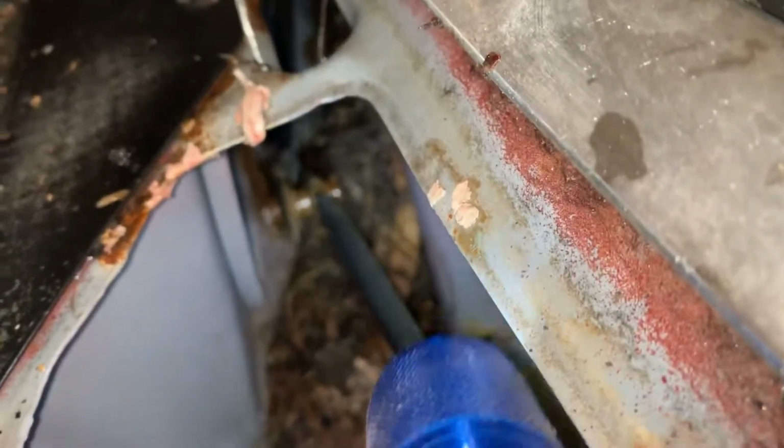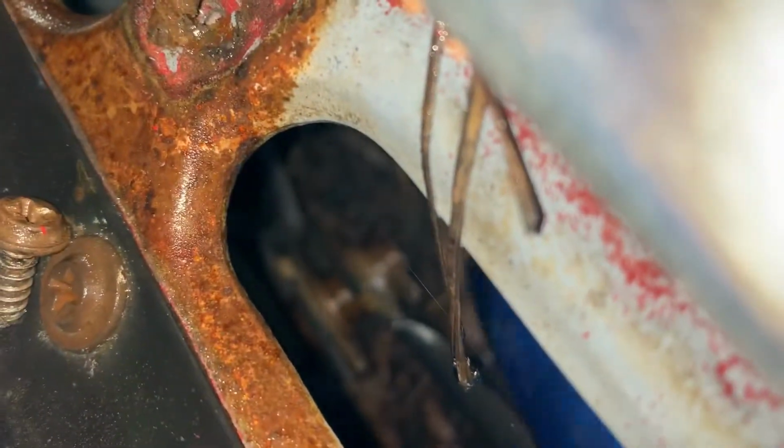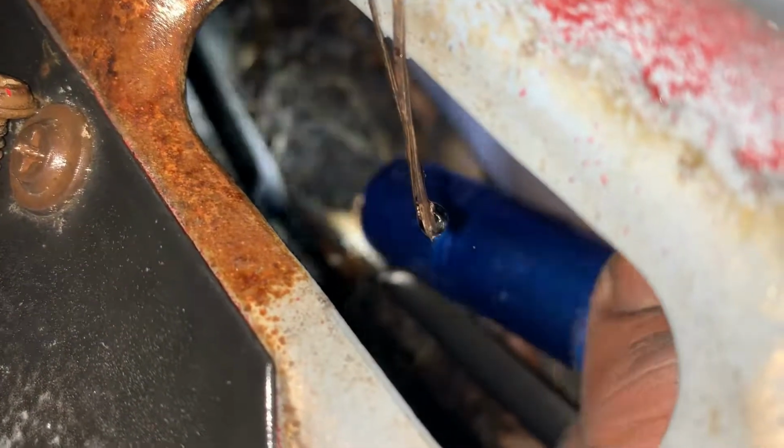And so what we gotta do is, there's a clip. Should be a clip at least. There's a clip at the end. Can you see it? The end of that thing, there's a clip. We need to take that clip off so we can slide these poles off. Then put the new motor in. Guess you can maybe see that clip at the end right over there. We're gonna get some pliers, take that clip off, slide the poles off, new motor, and start the reassembly process.